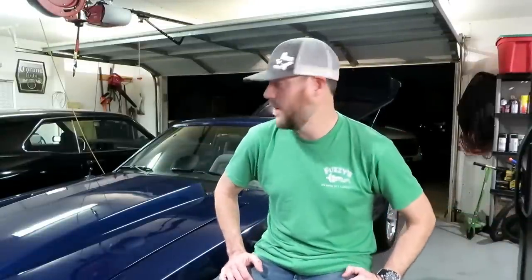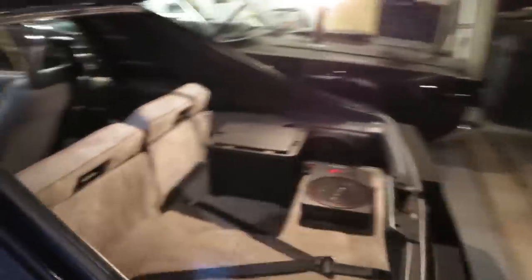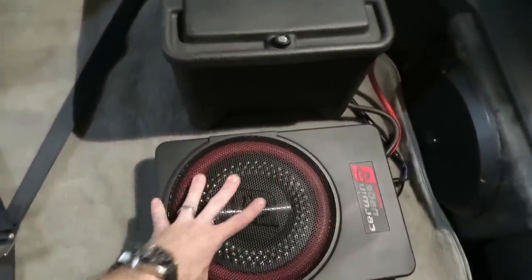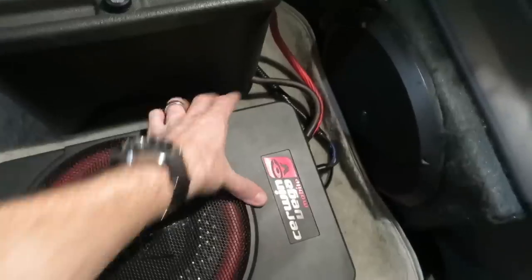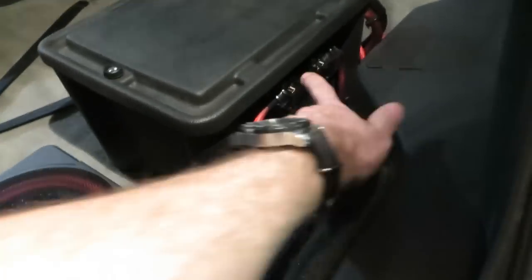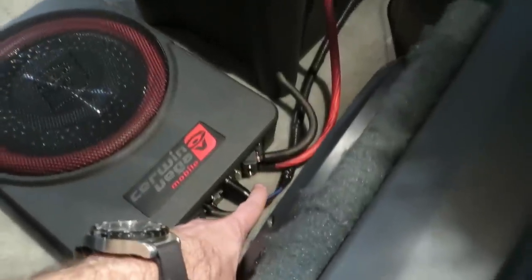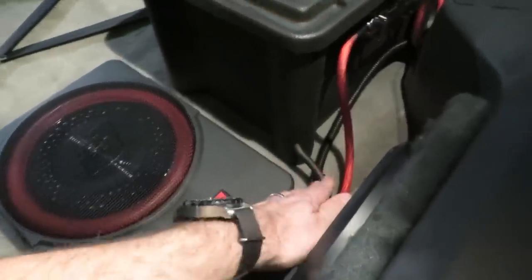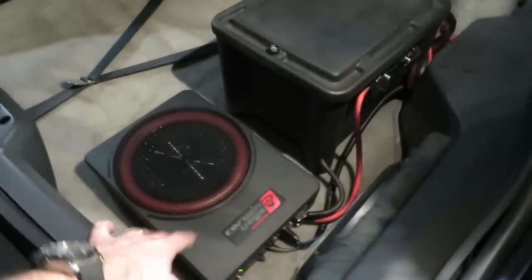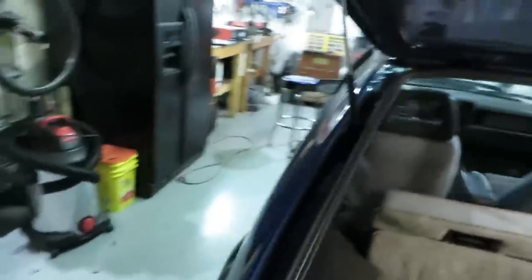Let me show you the install. Back here in the trunk — I cleaned it up a little bit. The best spot I could find was right next to the battery box. It's mounted and screwed down into the trunk on the corners. I've got it wired directly into the battery box with an independent fuse and went overkill on the wiring — four-gauge wire — with everything routed up to the car nice and neat. This thing is so loud I actually had to turn it down halfway.